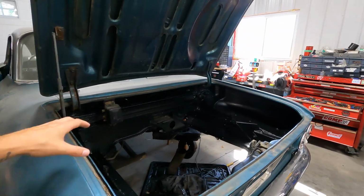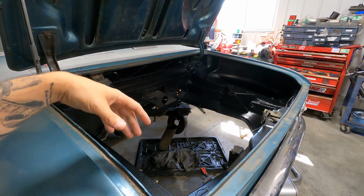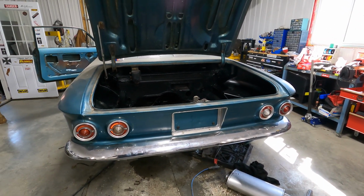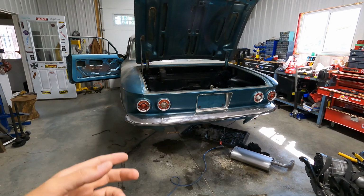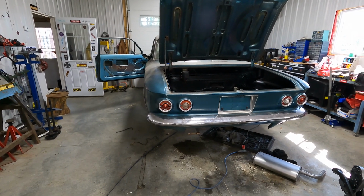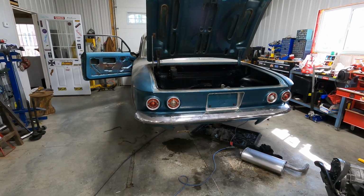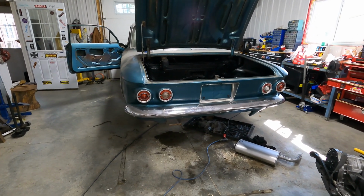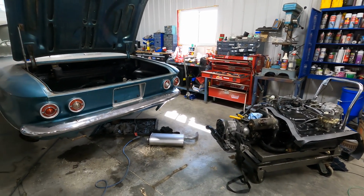I'm going to have a little bit of wiring to do because I have a new engine bay harness, and I have to configure it for my internally regulated alternator. I do that in all my Corvair stuff. The only thing I have left to do, I think, before I put this JMS engine in, is I need to pull the heater fan, the blower, out, drop the mouse house-ness out of it, and then do a quick test on it to make sure it works. It's a little bit of a pain to get at when the powertrain's in. It's accessible, but it's more accessible right now. So I'll probably do that first, and then it's time to maybe trim up that perimeter seal and look at installing this engine.